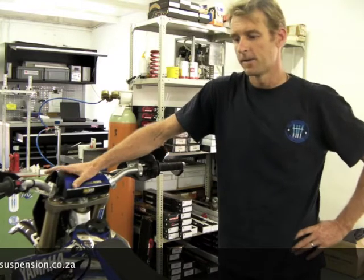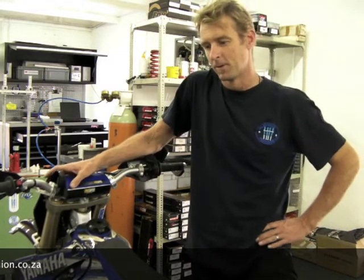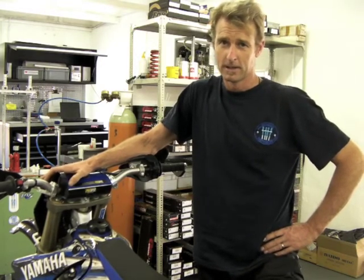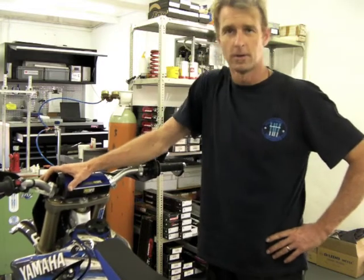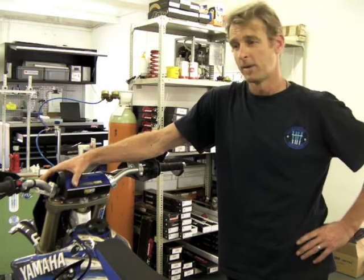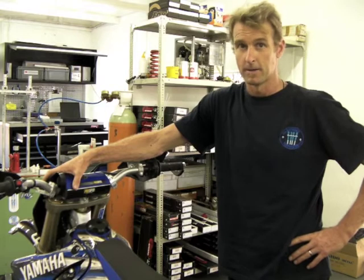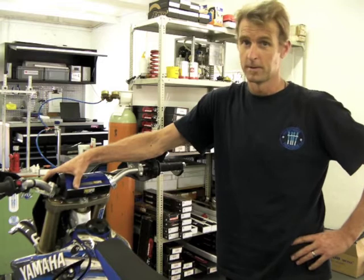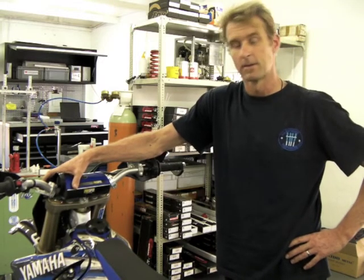In 2003, the fork was still pretty crude — it was one of the first upside-downs. We had a 14-millimeter spindle originally. Then in 2007, we went to a 12-millimeter spindle, which reduces the amount of oil flowing over the base valve as the fork compresses. We found advantages with this — it's easier to control the damping with less oil flowing over the base valve. We still used the same piston on the base valve, but with the smaller spindle it changed the amount of oil flow.